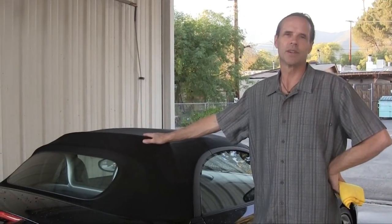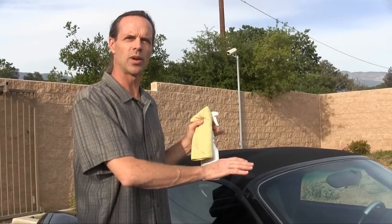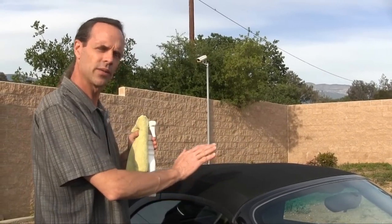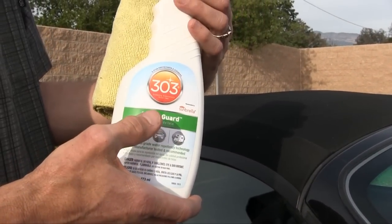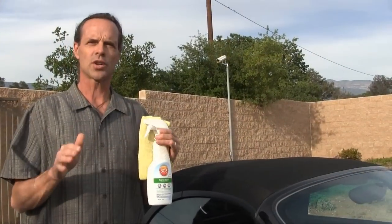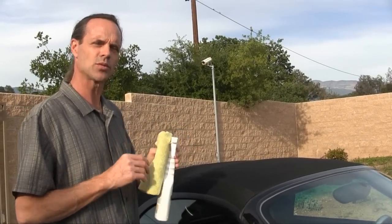The final step to this procedure is after the top dries, you're going to want to put on a sealant. Before you apply the protectant, you want to make sure that the top is completely dry — in this case I let this sit overnight. This is a canvas top and I'm going to be using a product made by Sunbrella, which is 303, and that's an excellent water-resistant protectant. If you have a vinyl top, you want to be using Trim Shine made by Stoner. The instructions on the 303 warn you of getting any overspray on plastic, vinyl, or rubber trim — that's why I have this other rag in my hand, so if I do have a little bit of overspray I can wipe it very quickly.